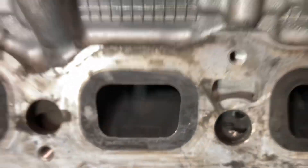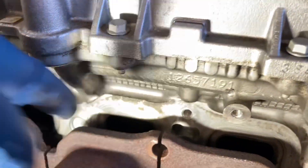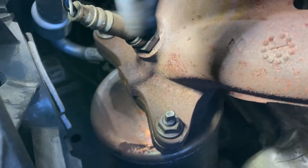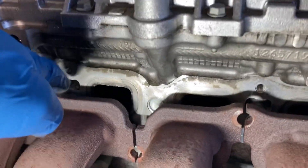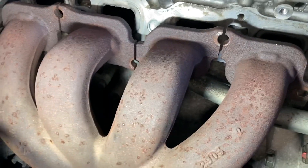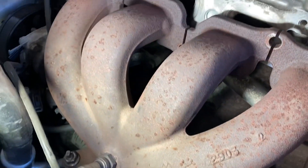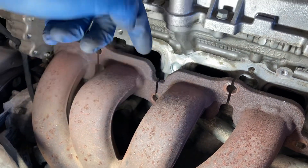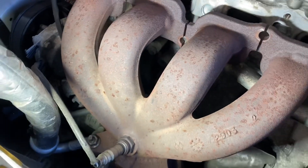Now it's time to tap the new plugs in. On reassembly, I first cleaned up the mating surface of the exhaust ports, then installed a new seal between the manifold and the cat — it's a round compression fitting. I'll put the manifold gasket in, lift up the cat and manifold, put bolts in loosely, then reinstall the bracket underneath. Everything threaded in snugly but not tight, then tighten the manifold to the cylinder head first, then tighten the cat, then tighten the bracket to hold everything in the optimal sealing position.